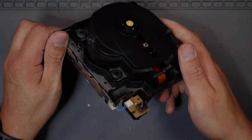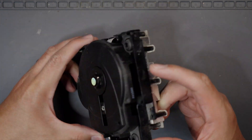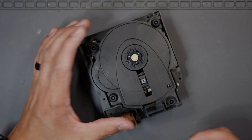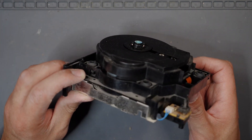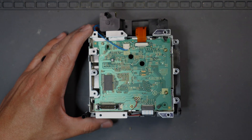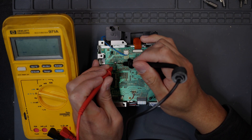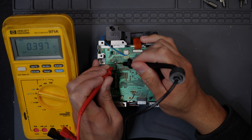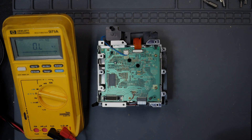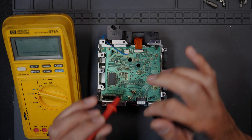There's our laser assembly. If you ever have to take it completely off, you pop these out — there's a little latch here and a latch on the other side. Once you pop that off, you can disconnect the ribbon and get to the laser from underneath, but that's only if you need to change the laser. We're going to mess with this pot right here. Starting baseline is 400 — 397 — so let's go down from there. It is reading just barely, so we'll try 341.